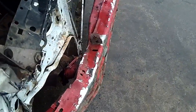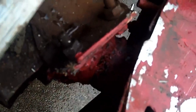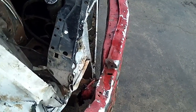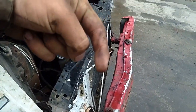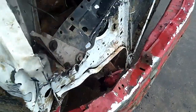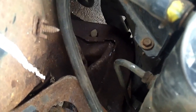The bumper actually held up really good. It did crush in here and it is starting to tear — it did crush in. I might just leave this bumper on and go back out there. What I might do is jam a piece of tubing inside there and weld it in to give a little bit of extra strength to this car. Just right down in there is where it bent — that whole top of the frame section kinked open, and I think the bottom did too. Where the seam welds are, I should have welded that. That thing tore right open.